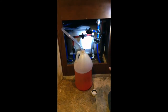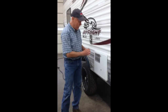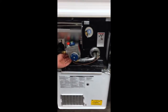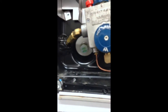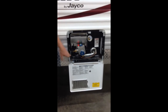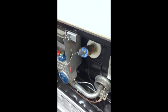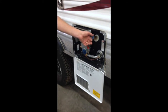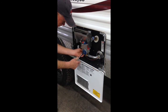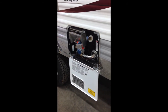Now we're going to go back outside and make sure that our water heater is drained. On this trailer, this is our water heater location. You want to find where your drain plug is — it's typically over to the left side, right here. If it's a plastic plug such as this, it's a 15/16 socket. If it's a metal one, it's an inch and one-sixteenth. Before you pull this plug out to drain your water heater, pull your pop-off valve or pressure relief valve — that'll keep you from getting a bath and releases the pressure built up in your water system. Then remove the drain plug and leave it set inside the housing so you don't lose it, and once that door is closed it won't go anywhere.